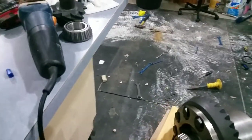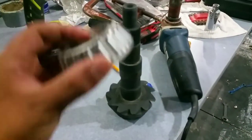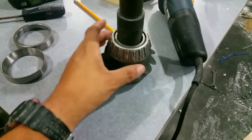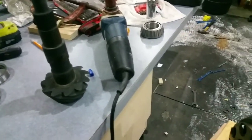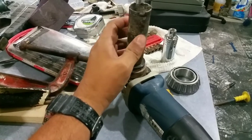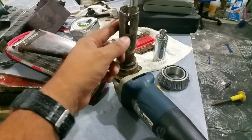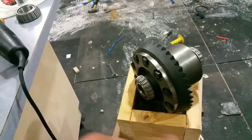Right now I'm working on building a setup bearing because I have to take it off and on to adjust shims. I don't have a lot of tools — mostly construction tools — so I'm using a granite hole bit that we use to cut holes for sink faucets on granite countertops. After I'm done with this I'm going to tape it up and put sandpaper on it so I can sand the inside of the bearing smooth.